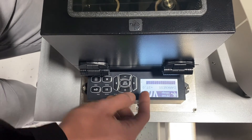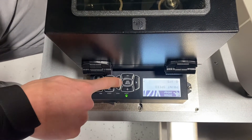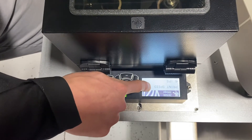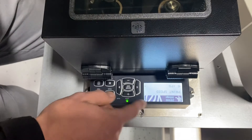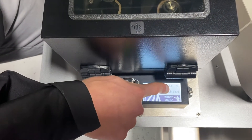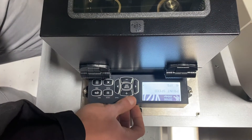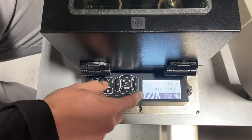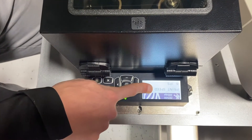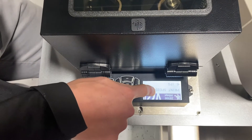I can go to my next settings in a continuous loop by hitting the right arrow or left arrow. Going to the right, here I've got print speed — this is how fast the label is traveling through the machine as I'm printing. Right now we're set at 6 IPS, which is 6 inches per second. If I start running faster and I've got some really fine and small font, it's going to start to mess with the print quality. So just be conscious of the fact that print speed does affect print quality.